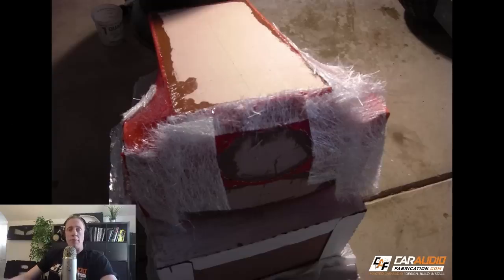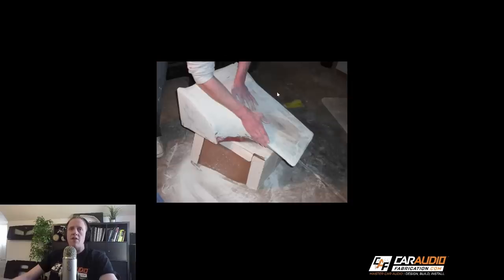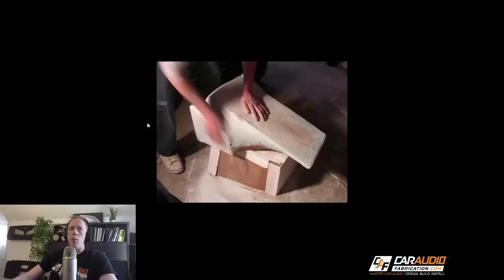I noticed I left straight edges when applying these fiberglass materials. I would only recommend straight edges when matching up with an actual straight edge - for curved areas you should try to tear the pieces as much as possible and get those fiberglass fibers to lay together with each other while putting the resin on. I'm now doing all the body filling process with lots of sanding. You should definitely look at getting some foam sanding blocks that really match contours well, so you keep the contour nice and consistent without finger grooves from uneven pressure.